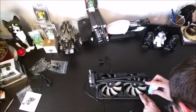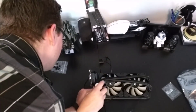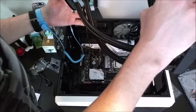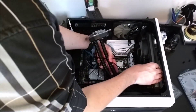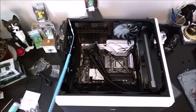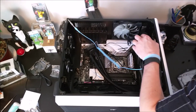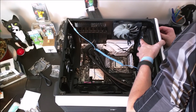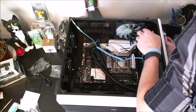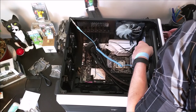The radiator is aluminum, so be careful not to over-tighten your screws. I did have to use a larger screwdriver to finish it off. Installing the radiator into the case is actually quite easy — the top part of the case pops off quickly and there are just a few screws to mount the radiator in place. Very easy to do; awesome case to work with, and I highly recommend it to builders.